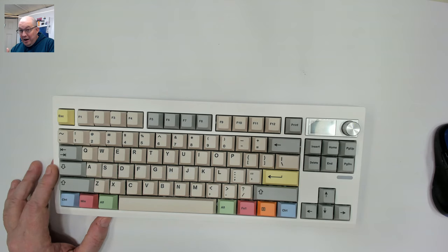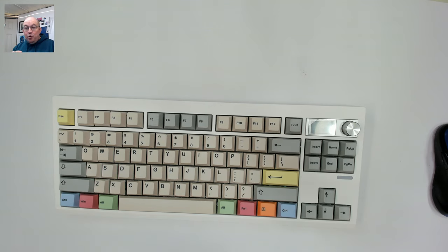So in those dropdowns, usually in that window, you can type in, you can literally create a kind of macro combination of keys. You can tell QMK to do a lot of things through QMK codes and methods. But in these clone or not real Vias, you can't do that. Macros still work. Most of these have four layers, 0 through 3, and you can do the mappings for practically any key.